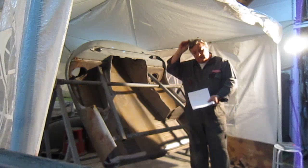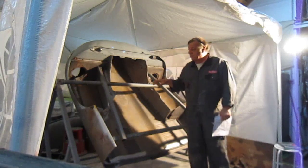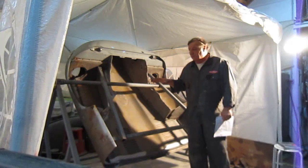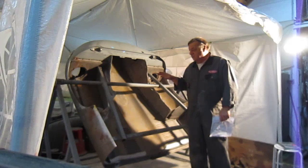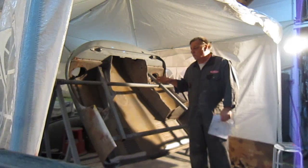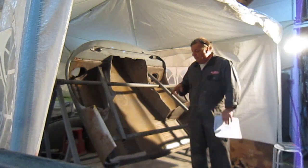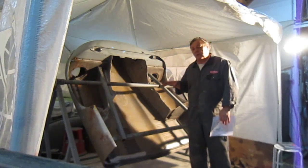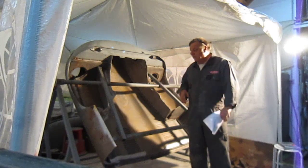I've had a few requests over the years. I made this bonnet jig about five years ago, and I was working pretty much on my own. This is an extremely difficult bonnet — it's more than a third of the car length, and it's very difficult to work with because you need three people to lift it, one on each arch and one on the front. So the only way I could see working on my own was to make something that would rotate where I could take the parts off.